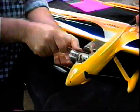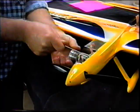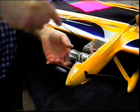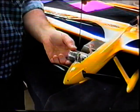Now, because the engine is new and all the bolts have just seated in, I'm just snugging each one up before I bother driving all the way up to the field and making people crazy. Muffler bolts, usually after they heat and cool a few cycles, could use a little more.